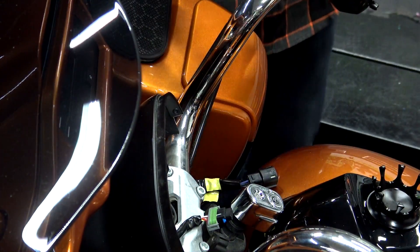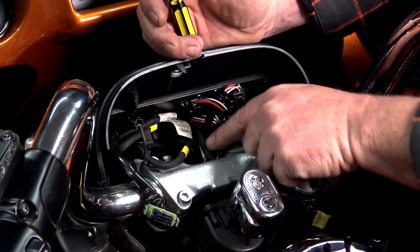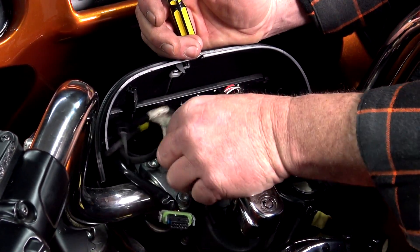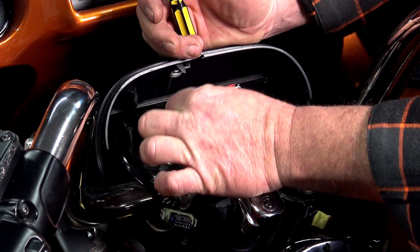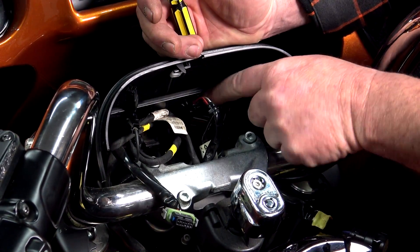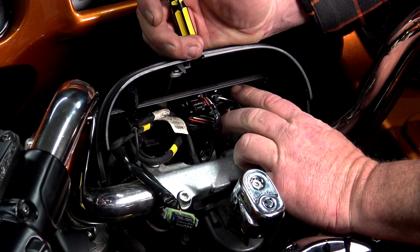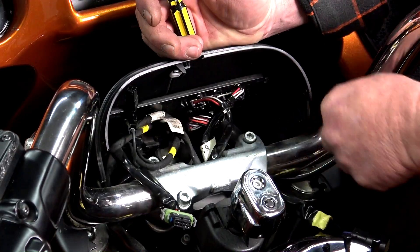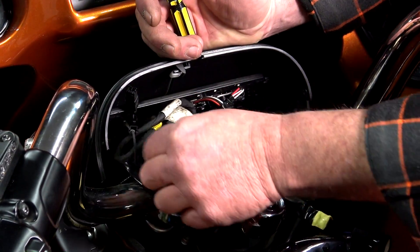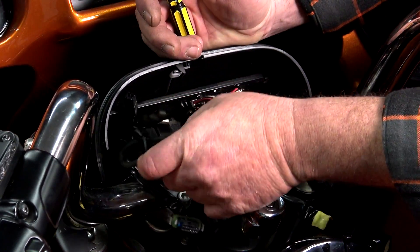Remove that cluster. Once we get in here, we have a few wires to disconnect. You'll see the wires coming out of the back of the handlebars — very easy to follow. You've got one from the left side that goes up to the little tree at the top, and one from the right side that has a double, so you've got three on this little electric tree. Follow the throttle-by-wire cable out of the right side; there's a zip tie on there you need to cut off so you can pull it out.